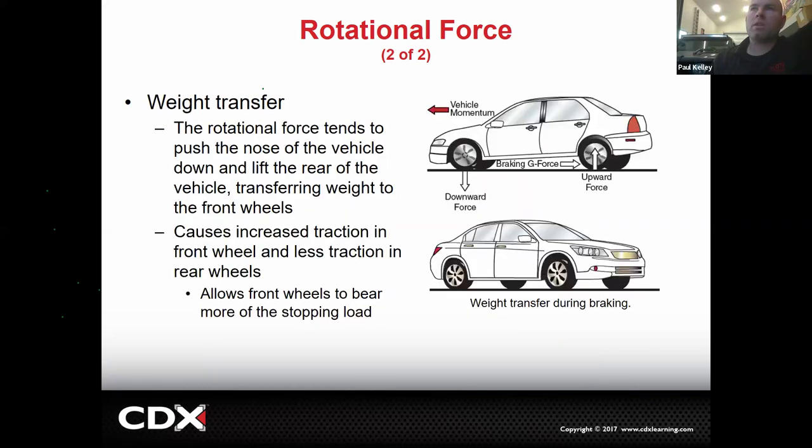And so additionally, it talks about the weight transfer. Like we talked about, you jam the brakes, the weight is shifting to the front. It's pushing the front tires down. Those tires got good traction. These are the tires we really want to send the braking force to. These ones back here, not so much. So we get into proportioning valves even later. The ABS system is critical in this type of situation. This is also the reason. Did you guys know, in a front-wheel drive car, where should your best tires be?